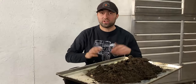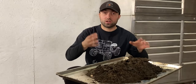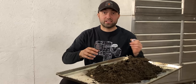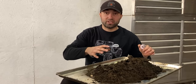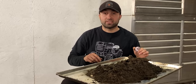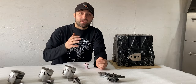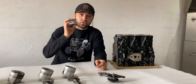That leads me to another topic: heat. I'm not just talking about the thermostat — I'm talking about debris collecting around the radiator so the engine cannot cool down. This debris was all removed from around the radiator area, including around the oil cooler for the transmission and hydraulic oil. This debris drastically minimizes the cooling effect on the Yanmar three-cylinder diesel engine. There's also another cooling system topic to address: the thermostat.